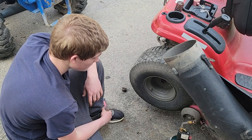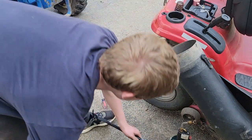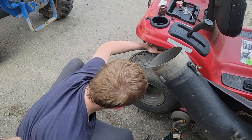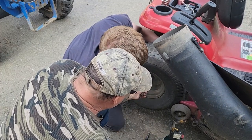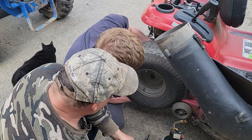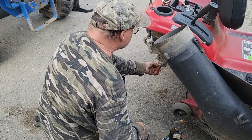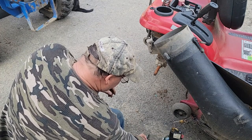We could use a tire iron and squeak it by that deck because the deck will wiggle forward. And then that should put it right in there — I should pry the tire back just enough to give you traction. You can pull that forward — probably a two-man job. Let me beat on that. We're going to lube this and it goes back together. What a project — they could have designed that an inch forward. But what do we got going on up here? We got washers, the spacer — yeah, I've never had this off so we're going to grease this so it can come off in the future. We'll grab our parts and then we'll go up and start that tire.